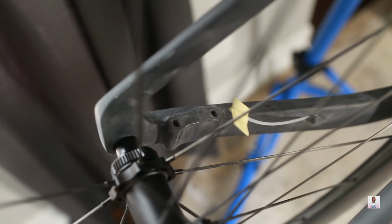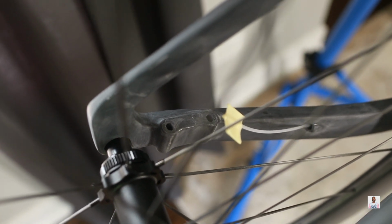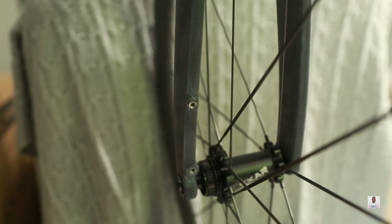Now moving on to the first impressions of this TanTan X38. It looks and feels just like every other unpainted Chinese frame that I've tested in this price point from $500 to $900 USD. It looks like there has been some attempt to face the caliper mount, and even in my past experience with these unpainted frames, I haven't had any issues aligning the calipers to prevent disc rub. It hasn't been an issue, so I'm not too worried about that on this frameset as well.